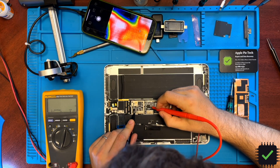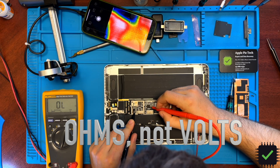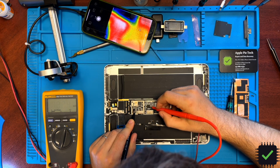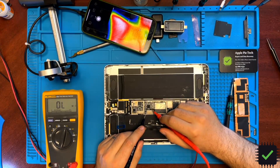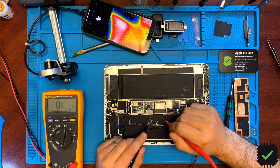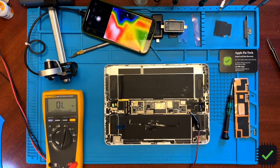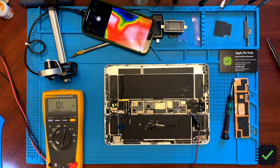This is the capacitor in question right here and you can see it's showing 122.9. That's in the area of the heat coming from the PMIC. What we're going to do now is inject 3.3 volts — actually 3 volts — to determine which is the culprit: the power management IC or the CPU. We can then test whether we need to remove the power management IC to resolve the short.